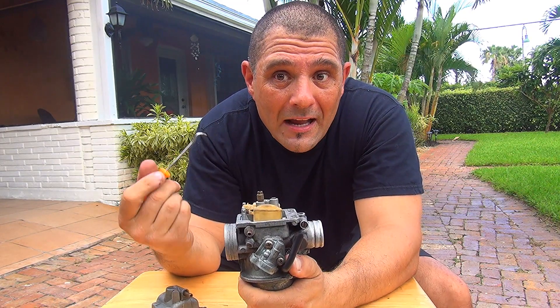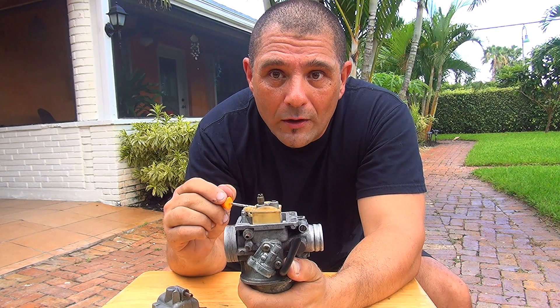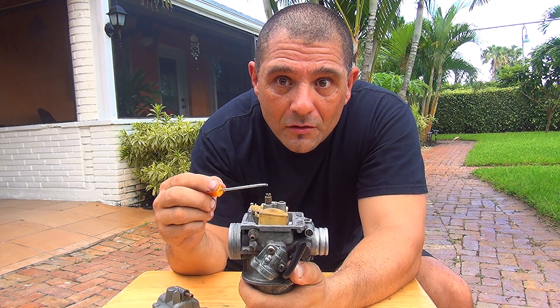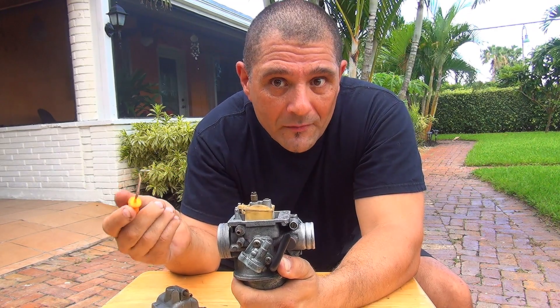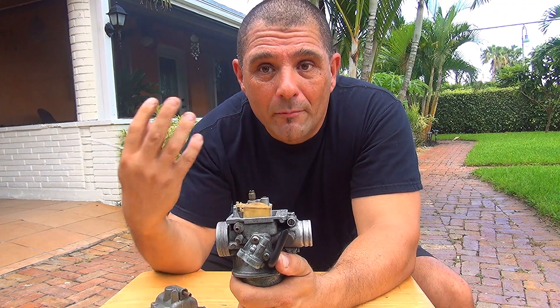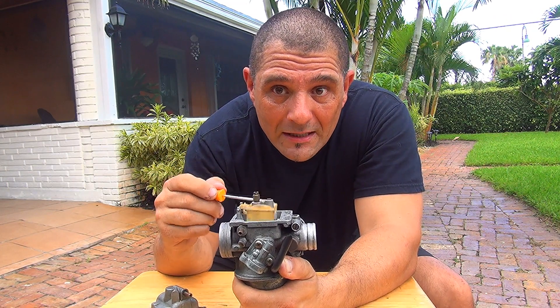The performance will be a problem and your scooter might not run perfectly because you have too much fuel. Also, when your scooter is not running, if your petcock — that is the fuel valve — is not closing perfectly, it will allow fuel to go inside your engine. The fuel will go from the carburetor to the combustion chamber and then down the cylinder wall past the piston, mixing with your oil.